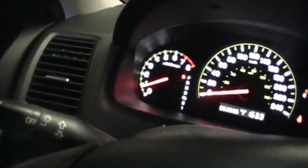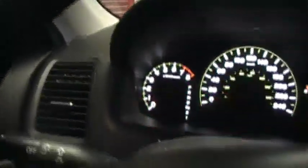So there's a little oil pressure indicator. We'll start the engine and make sure that goes off. And there we go. Now the DRL light will come on if your parking brake is on, but once you take it off, it should go back off again. But if that DRL stays on, most likely you got a problem with the module inside. So now that we're done that, we're going to top up the oil. That's the only thing left to do.